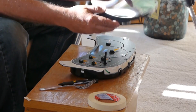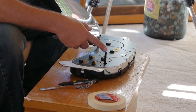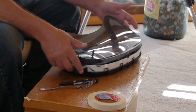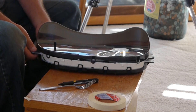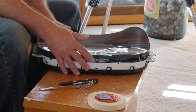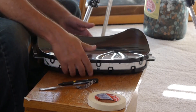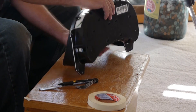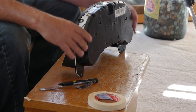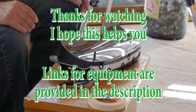You can now take this unit and put it on — you want to drop the reset button for the odometer in there. On this side these tabs are going to drop into the slot, and then on this side it just snaps together. And we're all done. Now we're going to just do the reverse to install it back in the dash.